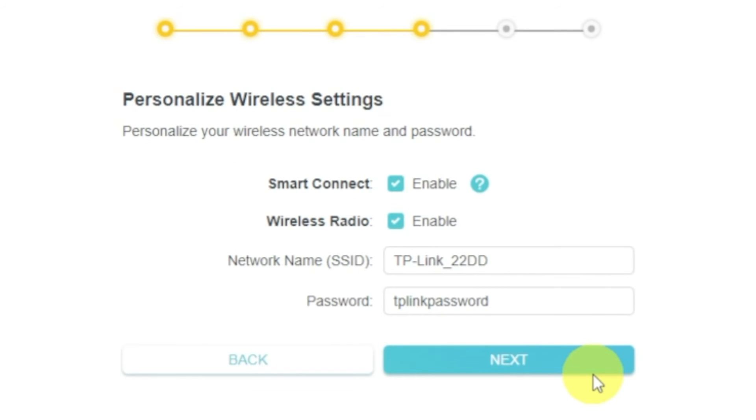On the next page, set the name and password of your future Wi-Fi network. You can enable the available modes of your router — there will be one or more modes available. If there are several, enable them and enter for each network the name and password. The password must be at least eight characters long. When you have entered the credentials, click the next button.